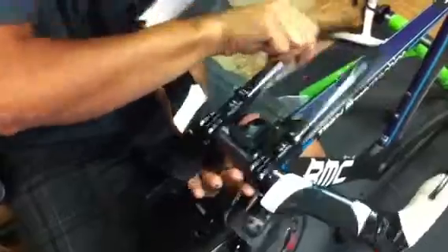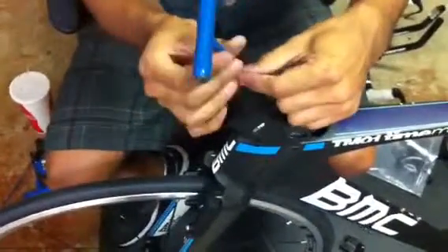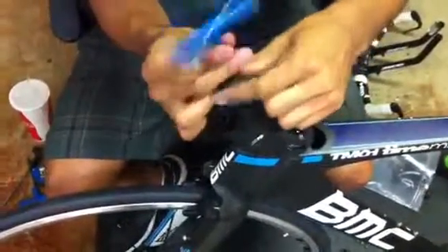I'm going to remove the bar completely, but for you the bar will be dangling somewhere around here. We'll get this out of the way. Next piece comes off — the clamp. Two five-millimeter bolts. We're going to remove this piece completely, and this is as far as we'll need to disassemble.